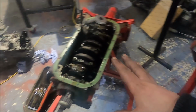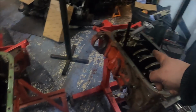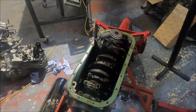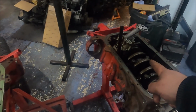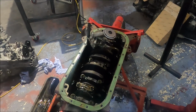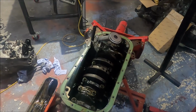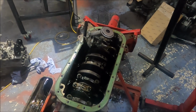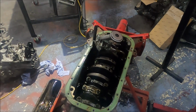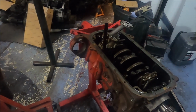One other thing I've noticed on these, but it's not a difference because they're both the same, is the oil pumps. I checked the part number, and this 3340 pump on these Penta engines is basically the best one, the highest volume oil pump. So, good news, because engines enjoy oil, and without it, things break. So yeah, the fact it's got the decent oil pump is a massive winner as well.